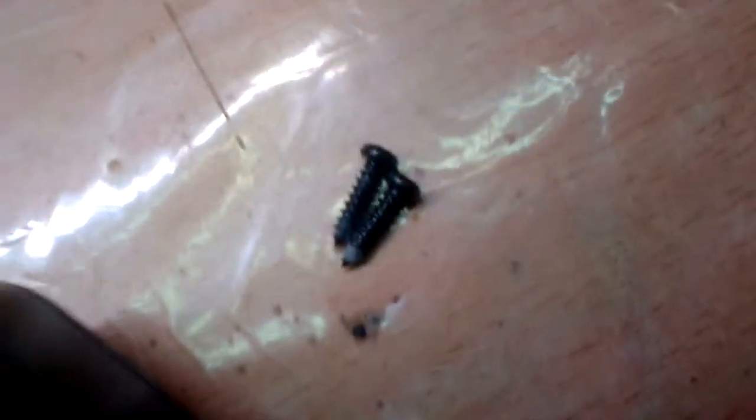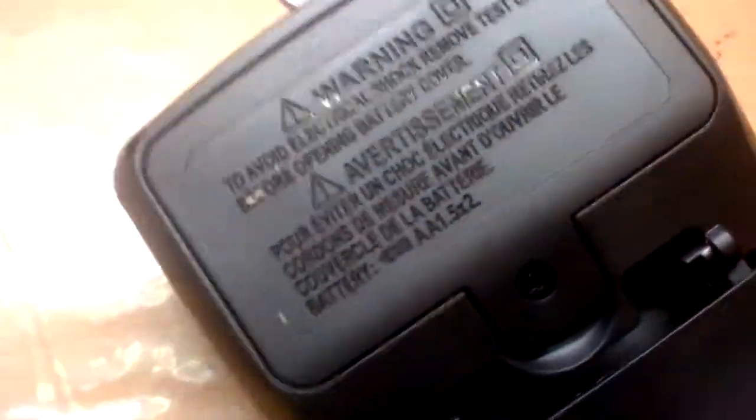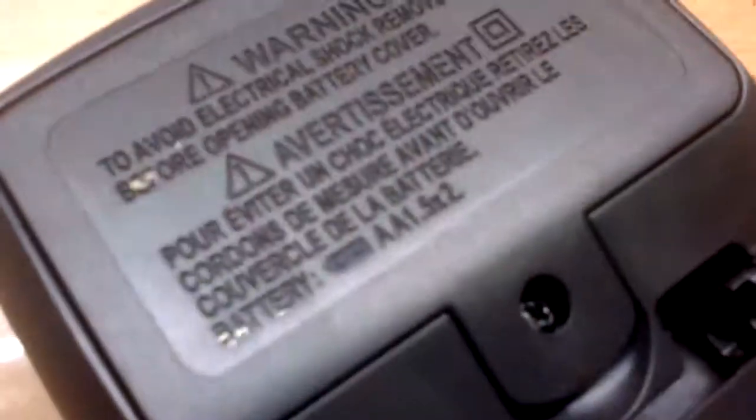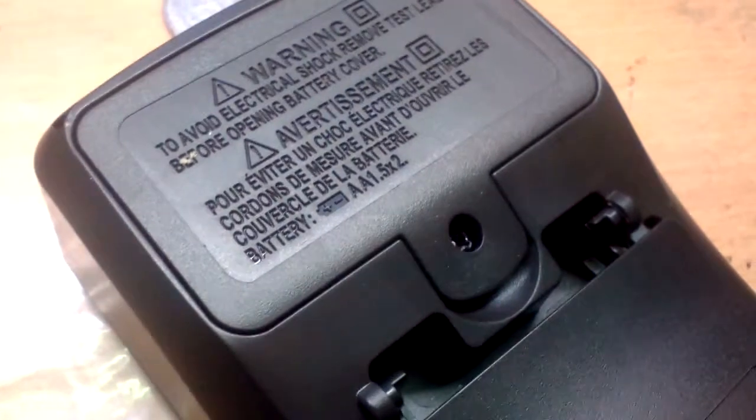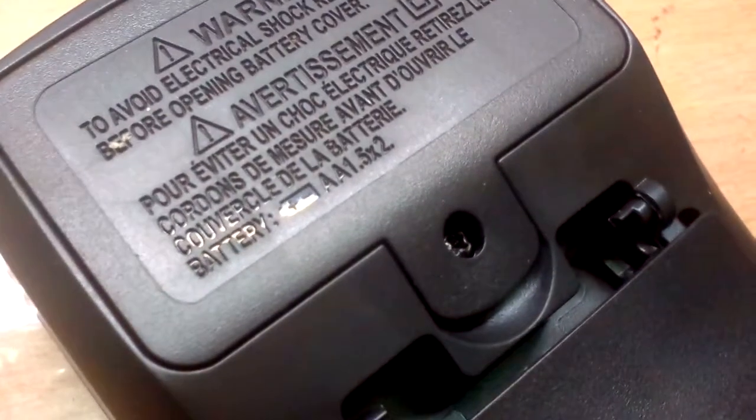You can see two screws underneath. I've taken them apart — they are self-tappers, which damage the plastic body over time. Here's one for the battery compartment. The quality of the plastic injected mold is quite good, actually shiny. This screw however is metal-threaded, which is good — it's not going to wear out over time. Let's open the device up.